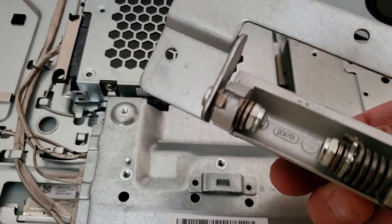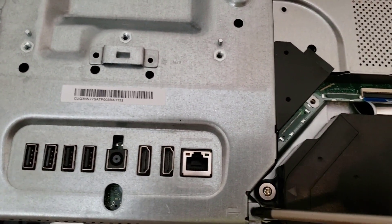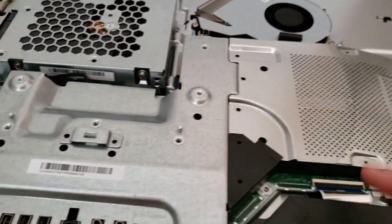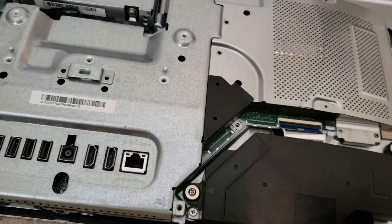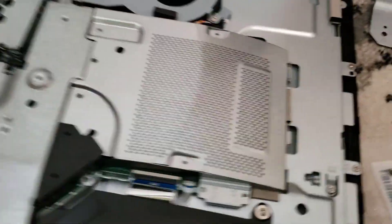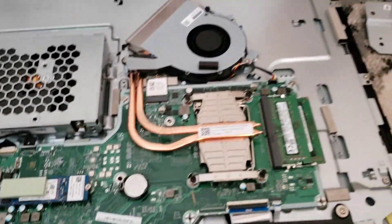Next, pull out the six screws to remove the mounting bracket — a simple spring-loaded bracket. There's a screw here, here, another one here, and one I already pulled. That lifts the whole bracket off. HP has also used tape on a unit here, plus a screw in the corner. Pry it up — it comes off as one piece. There are two hooks so carefully unhook it. That's the heat shield off.